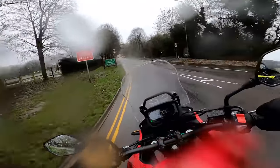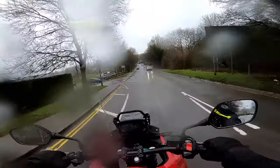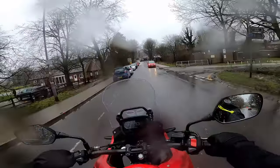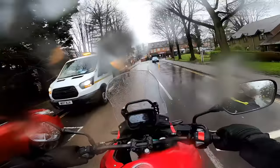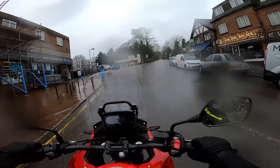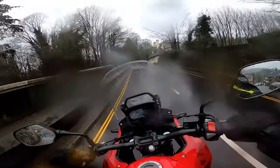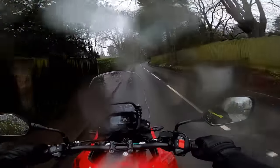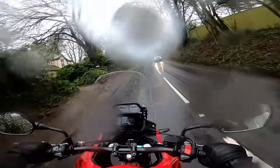In terms of technology, the bike has ABS — anti-lock brakes. So if you grab a handful of brakes, you can stop without fear of the wheels locking. There's no traction control, but it is a relatively basic bike. I've not felt I needed traction control — it's not like it's got a really powerful engine where you'd suddenly lose traction. The tyres fitted are Dunlop Trail Smart tyres, looking a little bit off-roady — probably 80% on-road, 20% off-road. No moments with them in terms of feeling slippery. Thumbs up for riding in inclement weather.